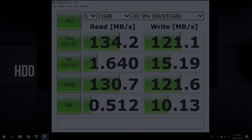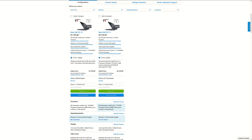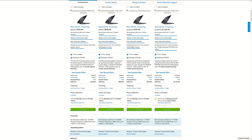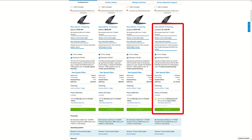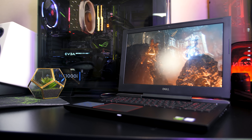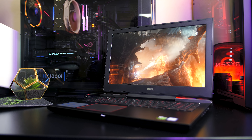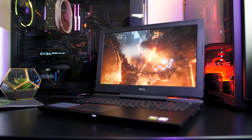Looking at CPU benchmarks, it's a decent step up from 7th generation as we've got two extra cores with slightly faster single threaded clock speeds, and there's a nice boost with the undervolt applied. In Crystal Disk Mark the 256GB M.2 SATA SSD was getting above 500MB/s in sequential reads and about 470MB/s in sequential writes — pretty typical for a SATA based SSD, though the laptop does support faster NVMe storage. The 1TB hard drive was getting above 120MB/s in both reads and writes, quite good for a 5400RPM drive. I tested the SD slot using a V90 rated card and the read and write speeds of the slot don't seem to be very good.